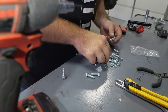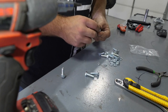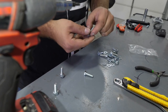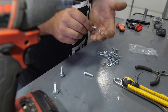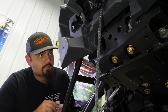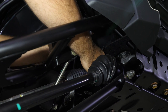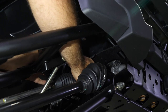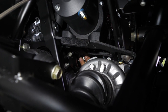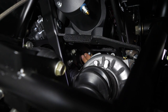In your hardware kit you'll have a bunch of bolts. Grab these bolts, lay a flat washer and a lock washer on each - do this to all four of them and then get them installed to the winch. Install hardware in an X-pattern: find the hole in the bracket, line it up with the hole in the winch, thread right in there, start the rest of your hardware, and go ahead and fully tighten them.